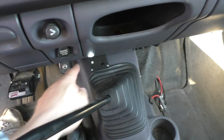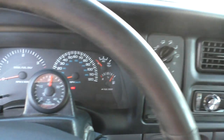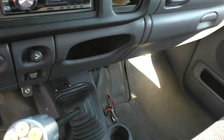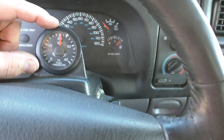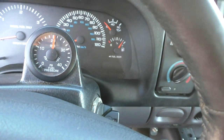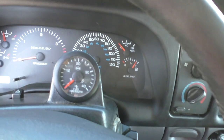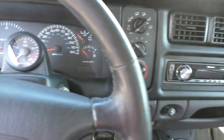I had to give it a 30-second head start — that's what the LED is for — to accommodate the warm-up time in the winter for the glow plugs. I've just turned over the starter; you can see I've got about 20 PSI fuel pressure and the LED has gone out, so the alarm is now armed. As soon as this goes below 5 PSI — which is what the pressure sensor switch is set to on the fuel line — the alarm triggers. There we go, it's going off: we have no fuel pressure.